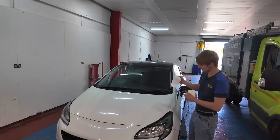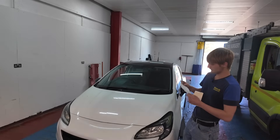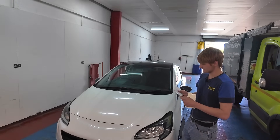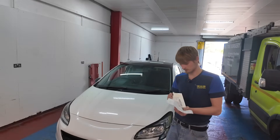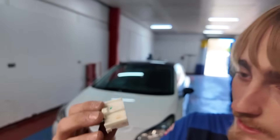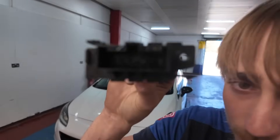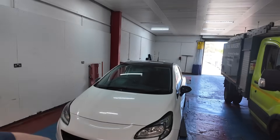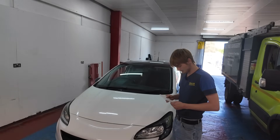I'm going to read the note quickly. It says: 'Me and my partner changed the resistor and the connection and a new bit of cable. The old resistor is in the box with the old connection.' So this is the old plug, and as you can see, pin 5 on there has burnt out. Same on the resistor — you can just about see in there, pin 5 is burnt out.